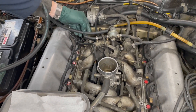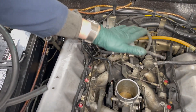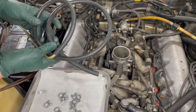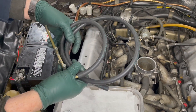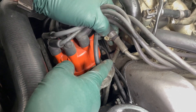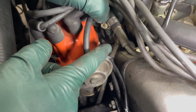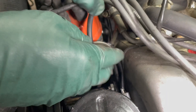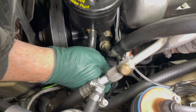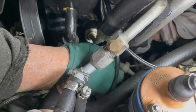When you get the kit, go one hose at a time — take the hose off, measure the length, cut the new hose, put it on, and go all around the top of your V8 engine until you've replaced all seven upper fuel hoses. I'm laughing because I forgot there's a hidden hose — this is the one that probably doesn't get changed and probably causes the most grief. Unless you follow this T-fitting down over to here, you're not going to find out there's another hose under there.